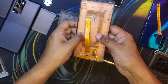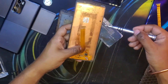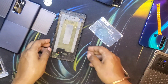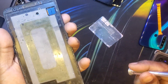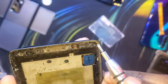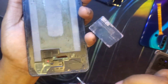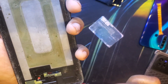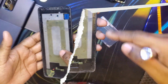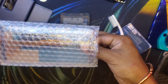This was the copy display that was present on the phone — it had all kinds of holograms and markings on the back showing it was not an original display by any chance. These are all the glue residues left behind; we need to clean them off as much as possible so the new display can sit flush with the frame. After cleaning off most of the glue residues, let's take out the replacement display.